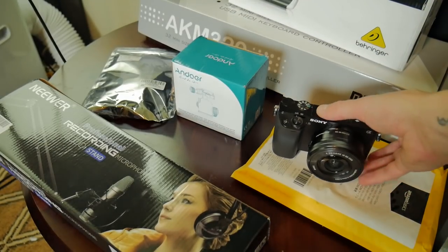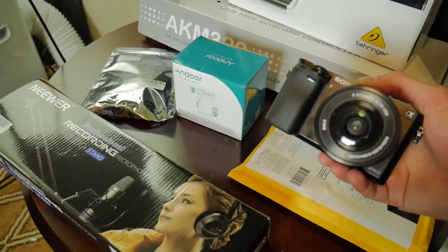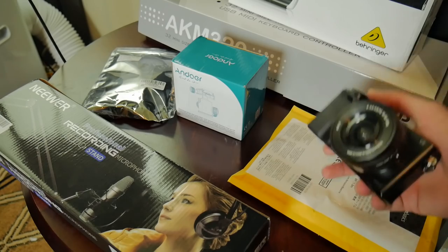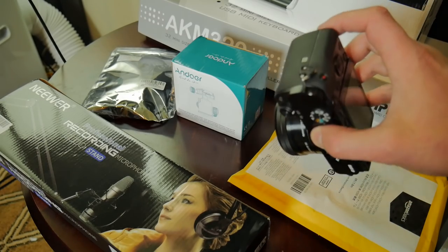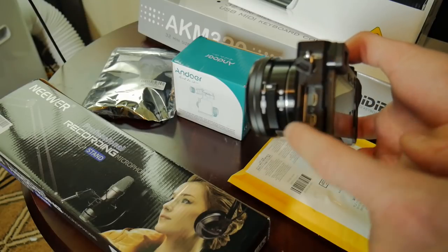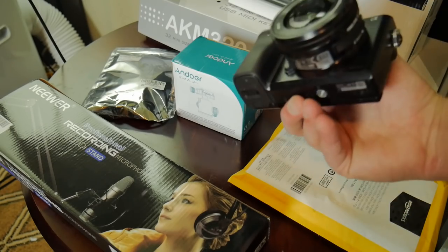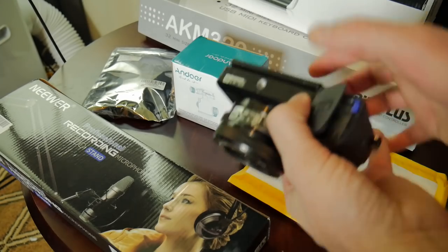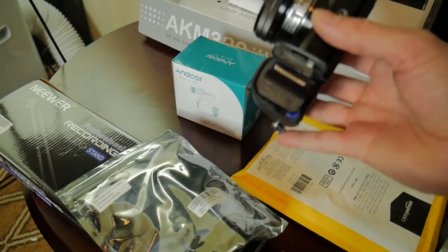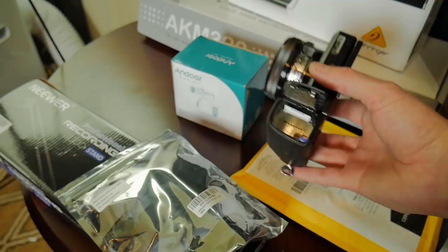The ultimate goal is to replace the C920 webcam with a Sony A6000, since I've been using that camera for YouTube videos. The way we're going to do this is a little interesting. When I initially tried it, I used the pass-through charging cable on the side, but the HDMI output would just turn black — it would no longer output. So you could only run off battery power. Sony and some third parties actually make an AC adapter that replaces the battery, which is right here.